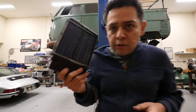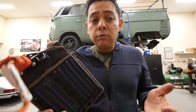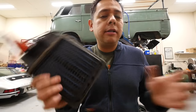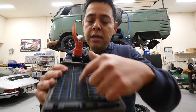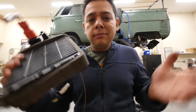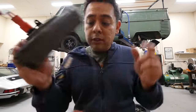Let's take a look at that Smart car heater. The challenge is the Smart has 90 cells in series nominal - that's 333 volts. At 100 volts, which is what the Samba has, this doesn't heat up - I asked Michael and he said it doesn't even start until like 200 volts or something. My thinking is that there are several individual strings of little heaters configured in series, and if we take this apart maybe we can rewire it to work at 100 volts.